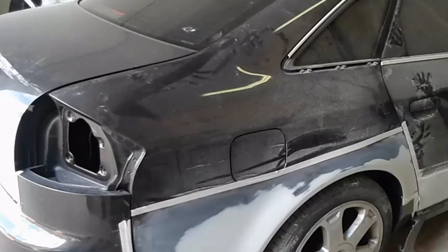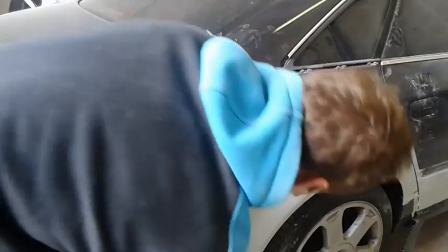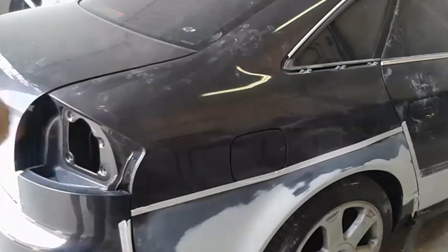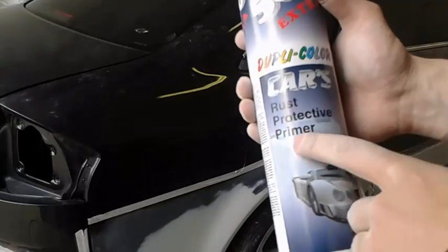After sanding with the P600, as I already said, you probably need to cover the putty and metal, and I did too. You take a primer spray can and apply about 3 to 4 coats. All of them are tiny coats, as you see in the video.